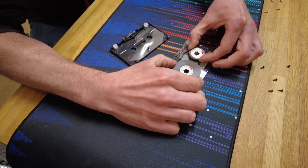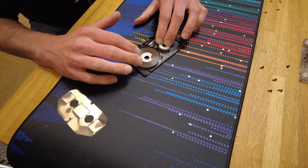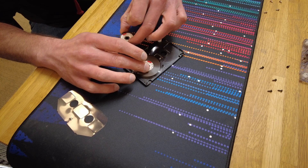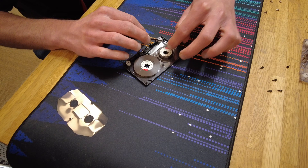Ideally you would rewind the tape before you do this — I could still do that as you can see, but I'm not going to bother. This is just a little video. The reason you want to do that is so you don't touch the tape — you touch the leader instead. But in this case we're going to take the tape out, grip firmly, and move it in one smooth movement to the other cassette shell, grabbing this foil as well. If you hear some rumbling in the background by the way, it is my washing machine tumble dryer.